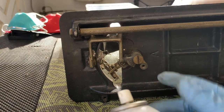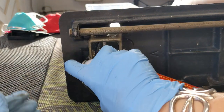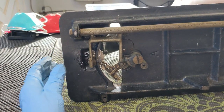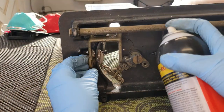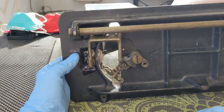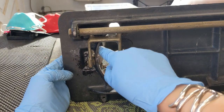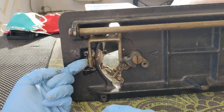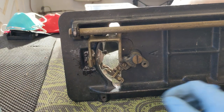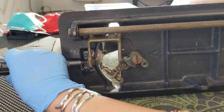This little point right there is the bottom of that screw I was having trouble with up on the top. So I am just putting some penetrating oil on the back side of it. I am going to need to get the feed dogs off of here before I can lift this up, so I am going to go ahead and loosen up this screw on the side which is attaching them, and see if just loosening that up is enough to get this bar free.